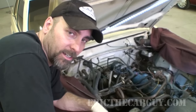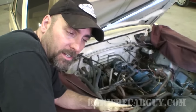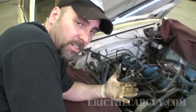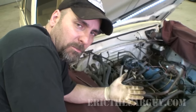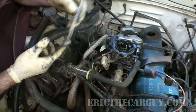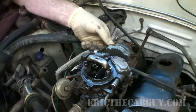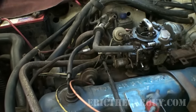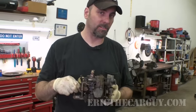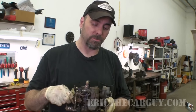There aren't that many vacuum lines on this carburetor, so I'm probably not going to be marking anything. Watch out for vacuum lines that go from one part of the carburetor to another — just leave those on. Work carefully and methodically, mark things as you take them off, and take a picture of everything before disassembly. Use line wrenches whenever removing fuel lines to avoid stripping. Here's my prize — and know that carburetors still have gas in them even after removal, so don't tip it upside down. Let's take this over to the bench.